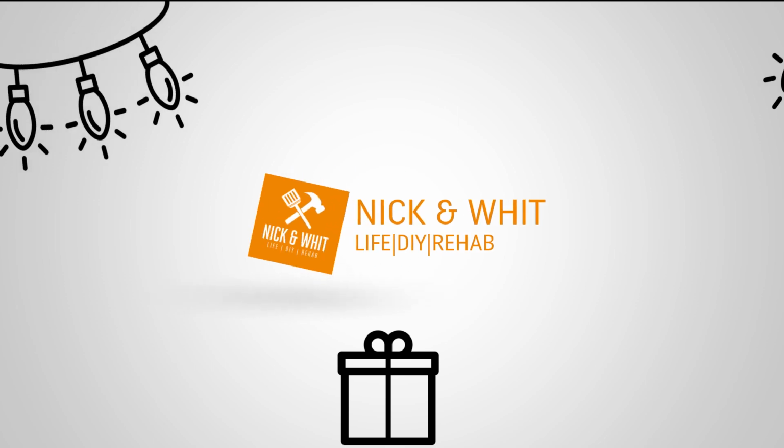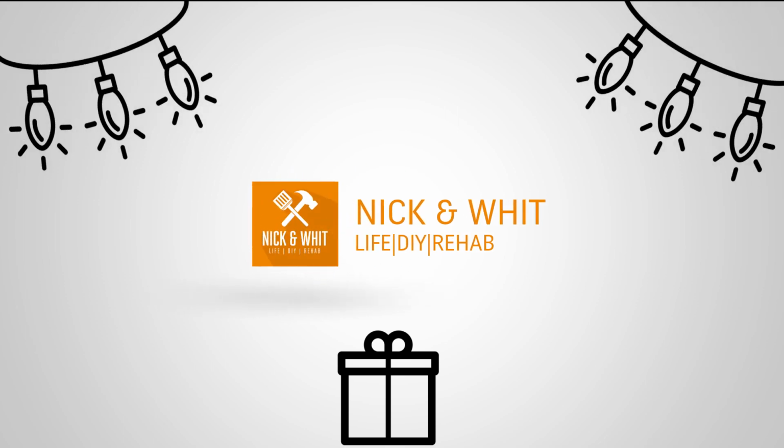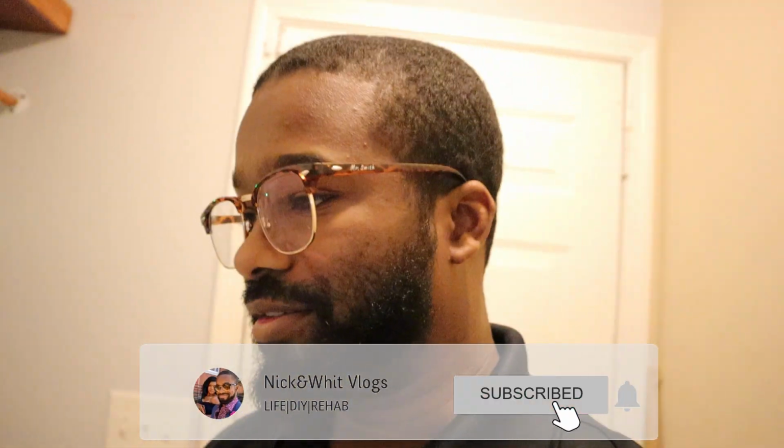It is 15 days before Christmas and the dryer broke. Man, I swear, it's always something. Whitney texts me Monday and was like, hey, the dryer's not heating up. I come home and I'm thinking that I just gotta clear some lint out of the duct or something, but nope. That's not it. I put everything back together, trimmed up the duct because it was too long in the first place, and still no heat. Now I gotta take the whole thing apart.